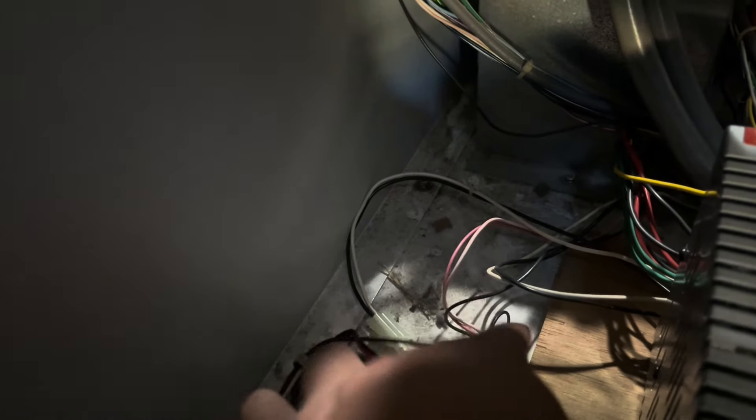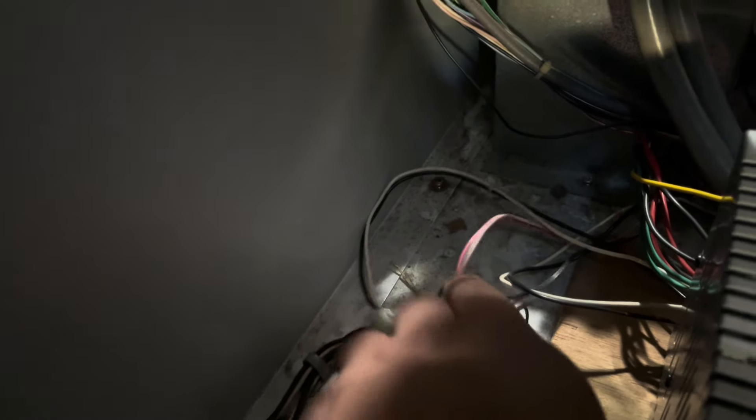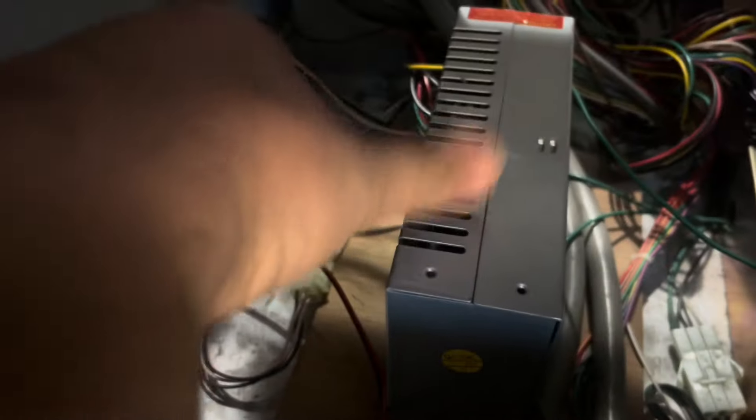I followed the original fluorescents — they're just wired in here. You can just disconnect it so the fluorescents aren't running. These are connected to this little power supply here. This is not the original power supply for the U4, but the original one died and I got it with this aftermarket power supply. I'm just going to tap into the 12 volts and the negative to power my LEDs from this, and you're good to go.